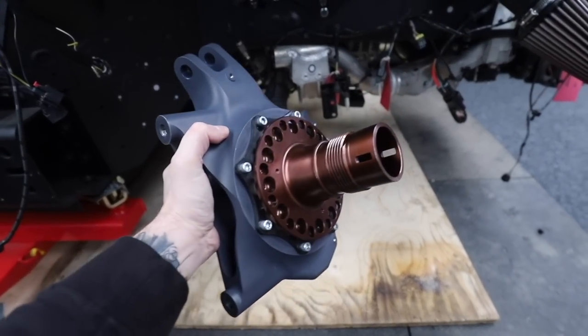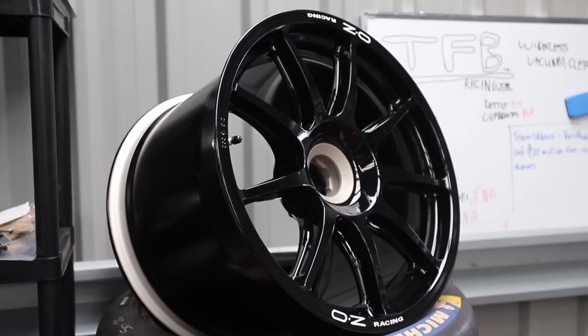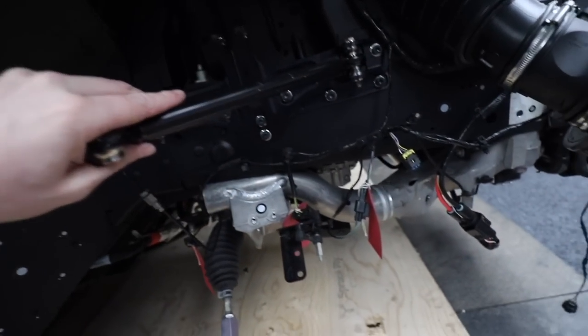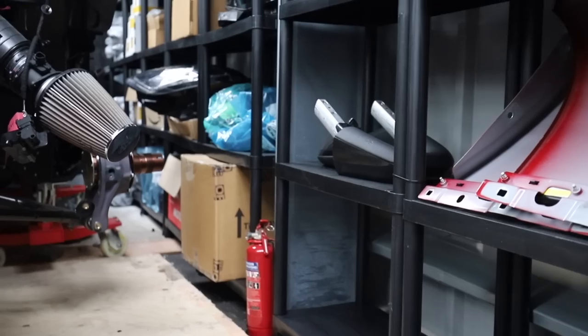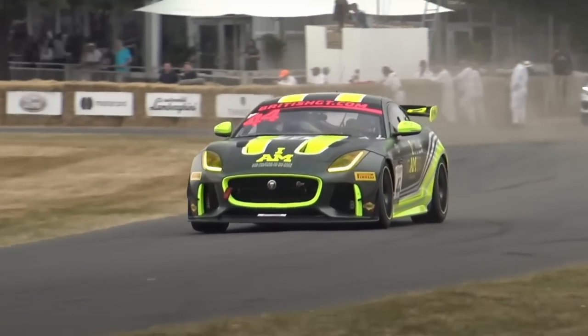This here is the hub for the car. As you can see, it looks nothing like one off an F-Type, because this car is going to be using centre-locking wheels — so it only has one wheel nut. All of these arms are mounted in completely custom places, so there's not really much F-Type left. I just want to give a massive thank you to Dan for letting me have a look around this car and also rummage through his parts bin. Dan is essentially converting that car from what was supposed to be just a race car into a road-legal F-Type LM, so he's got a hell of a job on his hands.